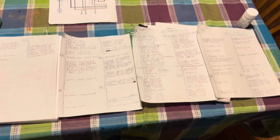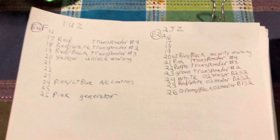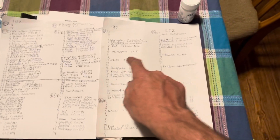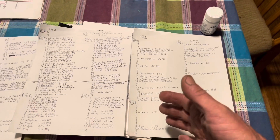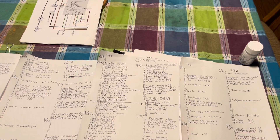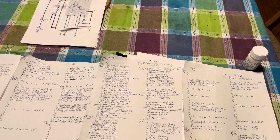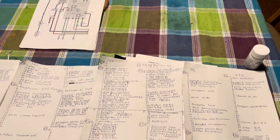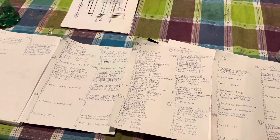It's been a long day. I've spent quite a few hours getting all this squared away, but I got all of the connectors pinned out and figured out what each one of them is. You'll be able to pause this and look at my pinouts if you want to, but verify for yourself — I don't want to be held responsible for anybody screwing up their car from going off my wiring. Now that I have all the pins figured out for each one of the cars, I'm going to start matching wire for wire, figure out what pins have to be moved, what wires are not needed, what wires need to be added. I'm going to take a break and go to bed and pick back up tomorrow to get the jumper harness figured out. Then it'll be moving on to the ABS and traction control computer, the instrument cluster, and the transponder for the key fob.